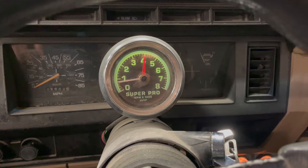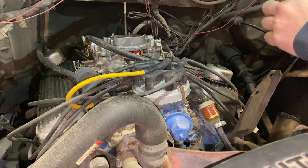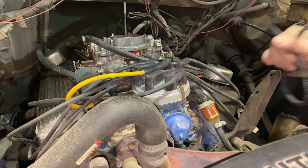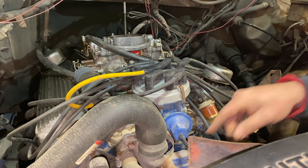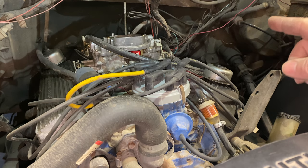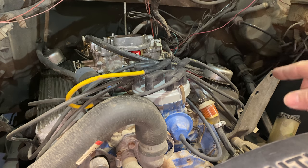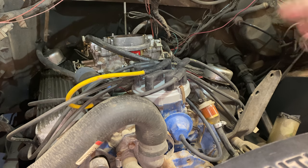This is already a huge improvement. Now let's hook up the vacuum line to the distributor so we get some vacuum advance. I think this engine is so sluggish because the timing is way off — I'm sure I'll have to check the timing. That sounded a little bit better. Let's move on to putting in new spark plugs. If this hasn't been running right those are probably fouled, and you really can't do any tuning unless you know your ignition system is working properly first.